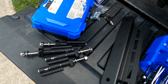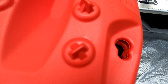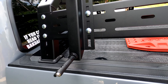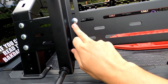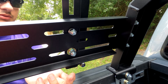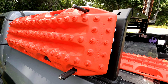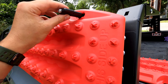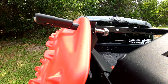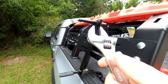The holes on the outside of the mount are what the posts sit in — they line up with the MAXTRAX holes just like that. I've got these loosely sitting up here with the mounts dangling on them. Just like with the bed rack, we've got a standard bolt and on the back side a bronze flat washer, a lock washer, and then the nut. Now that I have the orientation for the locks figured out, I can tighten them down onto the bracket so they're more rigid. This is going to be 17 millimeter.